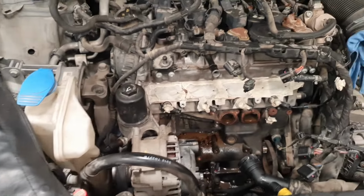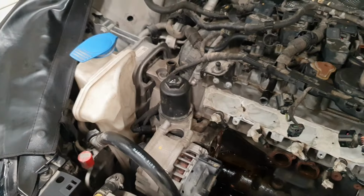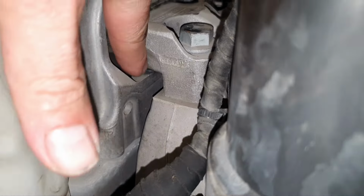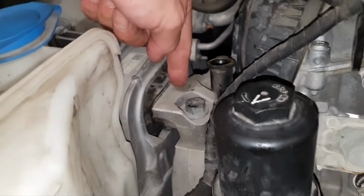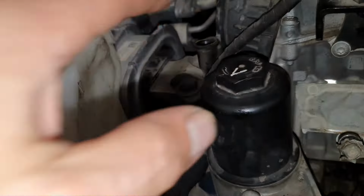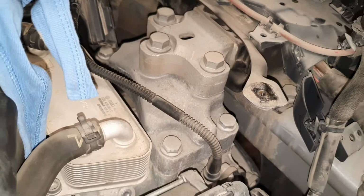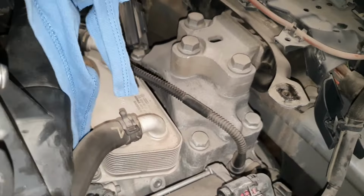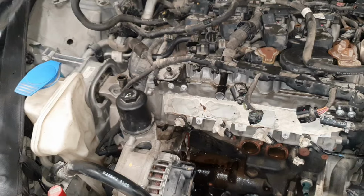That's the order. Another thing, Mr. Derek says to me that I didn't put it on the video before. He might be right, I don't remember, honestly. The engine mount, it's gone. It's touching metal to metal and it's fully down. You see that I can put my finger. This is not an engine mount anymore. It's fully seated down. It's gonna be a good thing to change if nobody changed before. I don't see any mark on the bolts. Change at the same time also the transmission mount. These two mounts to be replaced.